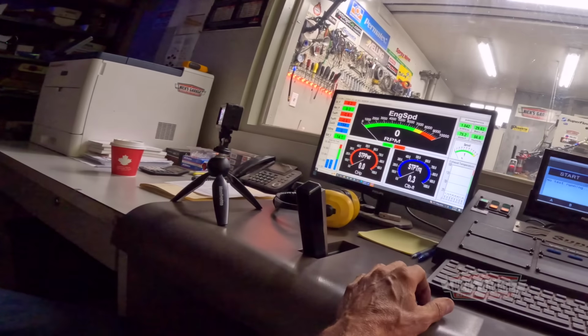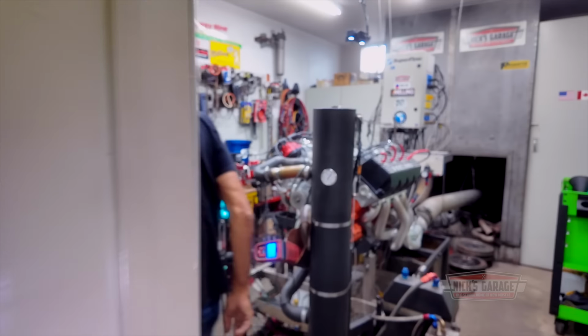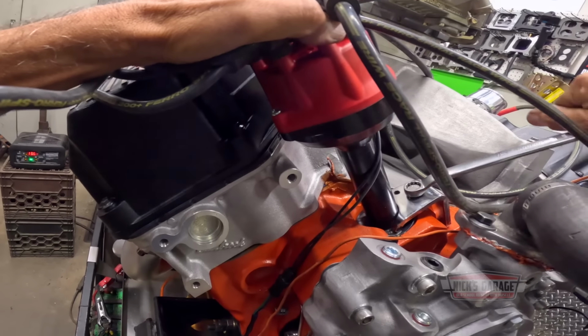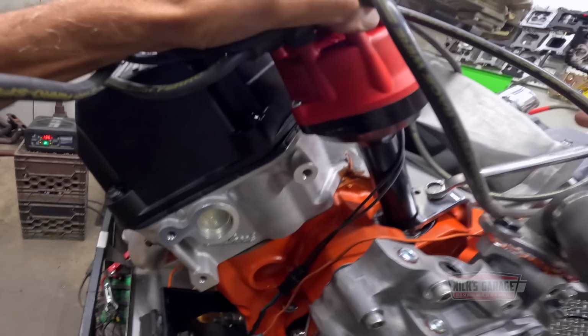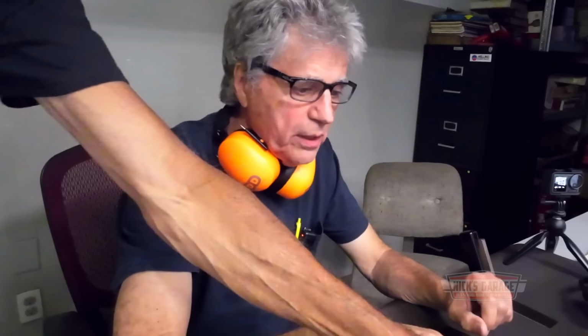I'm going to advance it a couple degrees, make another test. I don't think it's going to pick up. Hey, let's give it a shot. We're at 30 degrees. Here, I'll try 28. 28? You think so? 28, yeah. Okay, I'll back it up. 28. Start her up.